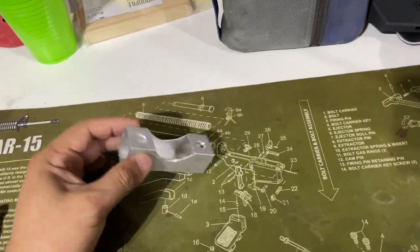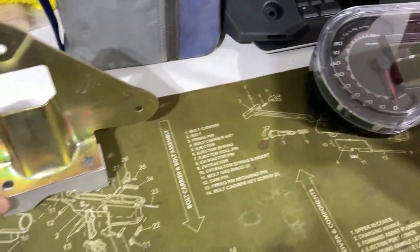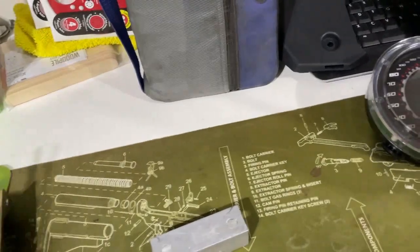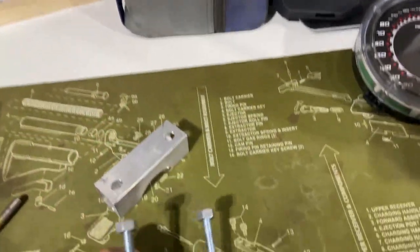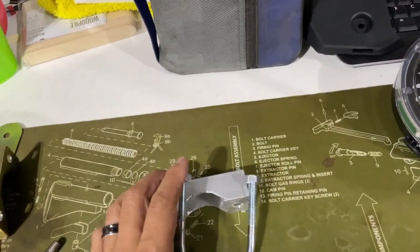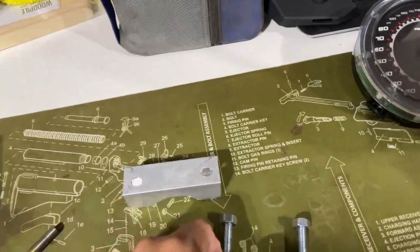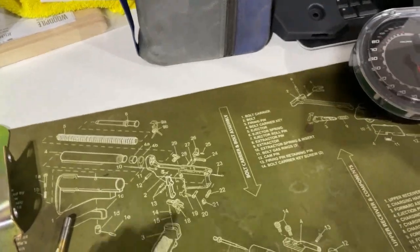Next, you're going to drill your holes. Flip it over, take your mounting bracket for the gauge, set it on top of the aluminum piece, mark the holes, and pre-drill them all the way through. Then run back through with a 5/16 drill bit for the final hole size. With the u-bolt going through those holes, it's not perfectly vertical — the threads stick out both directions — so I ended up wallowing out the holes a little bit, making them more oval on the top and bottom. That gives you enough play for the u-bolt to go all the way through and cinch down around the steering column.